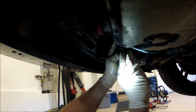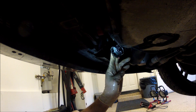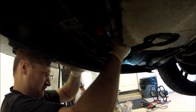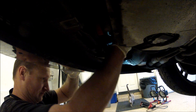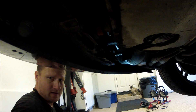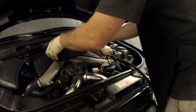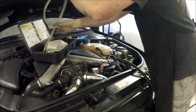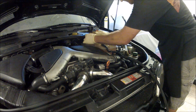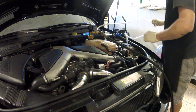There are two different diverter valves — I don't know what happened there, I'll have to talk to him about that. He mentioned there's no water in there so I'll look into that. The power steering fluid is low as well, so I'll add some fluids and see if it's leaking. It's general maintenance stuff I need to go through to make sure everything is good, and I need to find the exhaust leak and why he has a check engine light.